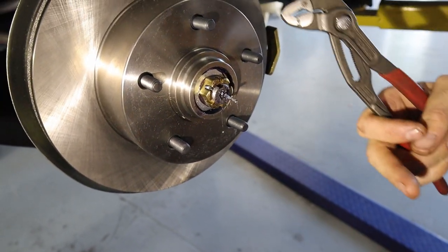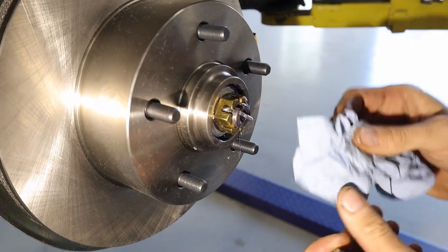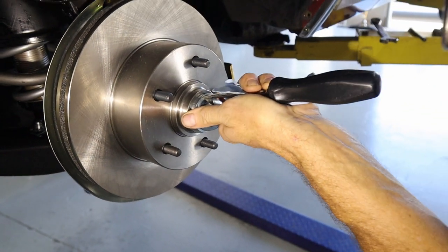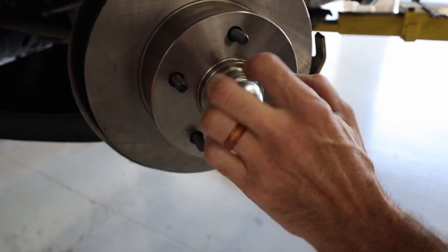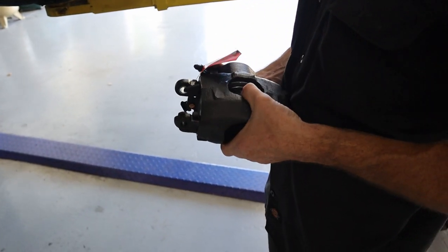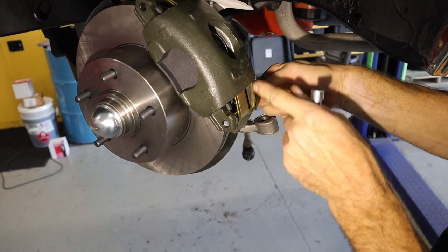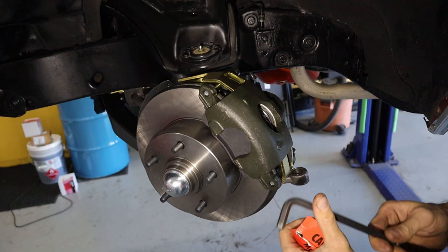Wipe off the grease from the outside and put the dust cap on. Use a screwdriver on the lip to avoid beating the cap and collapsing it — though that trick didn't quite work and I had to use a socket that fit around the outside to seat it square, since it was really tight. Now put the caliper back on the rotor — it has to go down straight because the caliper sits in the bracket. Watch the bolts and make sure the brake pad hooks over the top of them. Check that the bleeder is on top. Double-check which side the caliper goes on — it has an offset, and the brake line must be on the higher side.